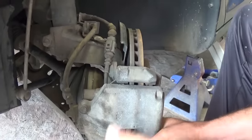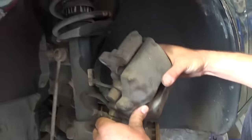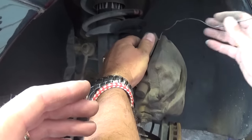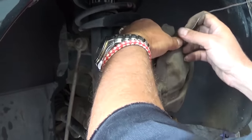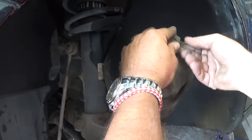You need to get a wire or a big heavy duty zip tie or something like that to make sure the caliper is not hanging on the brake line, because this is super dangerous. It is very possible that it will damage the brake line, which could break later and leave you with no brakes. So just make sure it's not hanging.